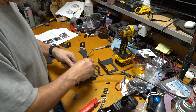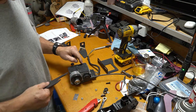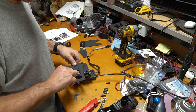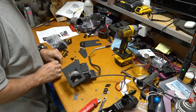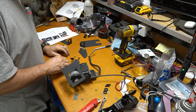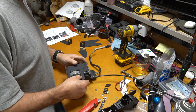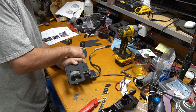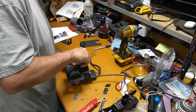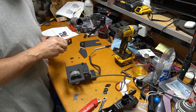Alright, that's good enough. So now I'll be able to lay that back on there. This particular cruise control servo — this hole up here was not threaded. I did run a tap down into that hole. So I'm going to use my own hardware because I know that I have it, and then I'll be able to put a bolt in all three holes. Don't really want the cruise control solenoid falling down at my feet while I'm driving — that could be bad.